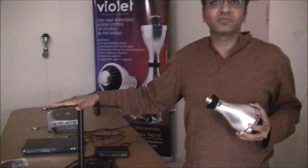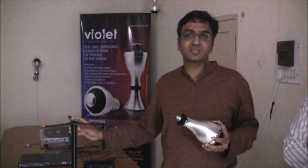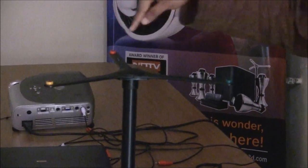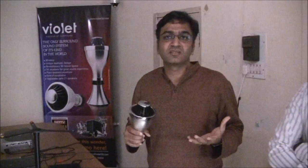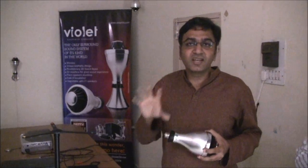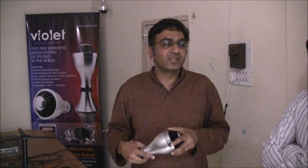That is done by this microphone, which is required once during the setup of the whole system. This microphone understands how many speakers you have placed, where you have placed them, and how the room sounds — then communicates all of this back to the transmitter, which tunes the audio to give you a surround sound effect. We call this a space sensing microphone. Unlike any other tuning mechanism, it has three microphones placed very carefully on an equilateral triangle, allowing it to sense the coherence of the space.